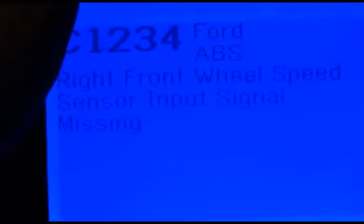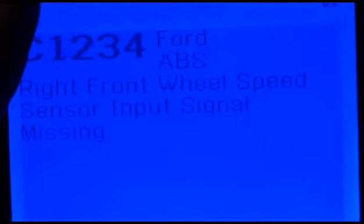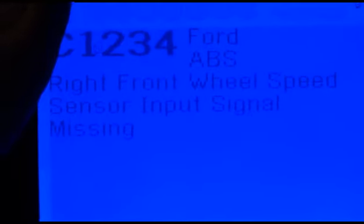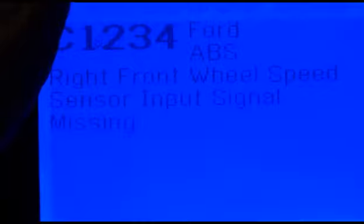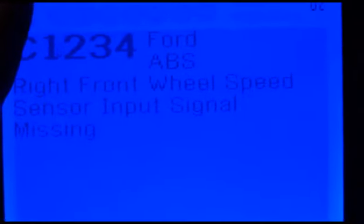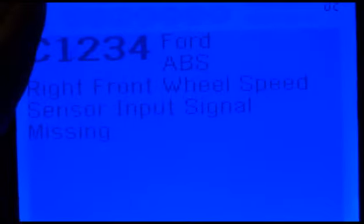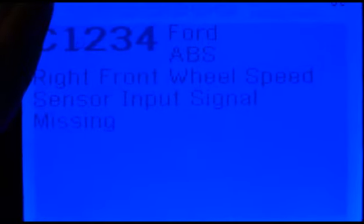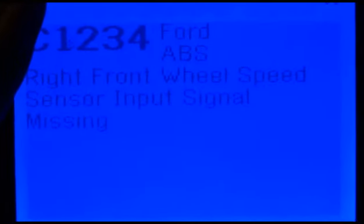I did quite a bit of talking there with my camera not on record. I pressed a bunch of buttons on this — I don't use these every day, so I was doing it very inefficiently, probably wasn't worth videoing. But you can struggle through it; these code scanners are pretty easy to use. They really don't have much for instructions but you struggle through it for a little bit. It took me about a minute to get it up, and fortunately it is the right front wheel speed sensor that is bad, and that's what we have taken apart. My only concern is maybe it's throwing that code because I have the right side taken apart right now, but I don't think so because it's not even showing any ABS codes on the dash — it was intermittently back when it was put together and running.